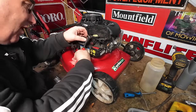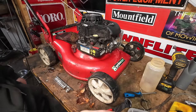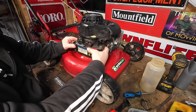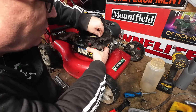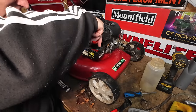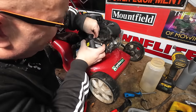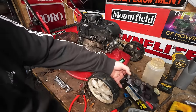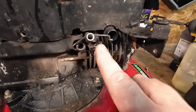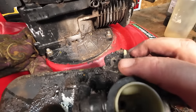With the throttle control out the way, you can now remove and retract the whole carburettor towards you, but be mindful there are one or two little tiny governor springs in place. Now's a good time to take photographs before you disconnect these. The spring - just get hold of it, tip it backwards on itself and it just comes off. Then the governor arm - there's a rotation going on: rotate it forward and then slip it out. Just there - rotate forward, and there's a little tiny spring that came off and sits on top of the carb.